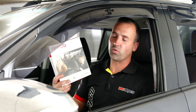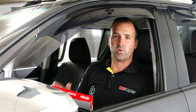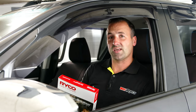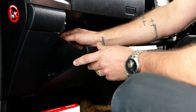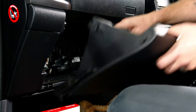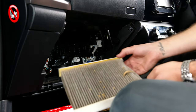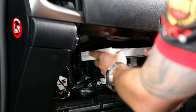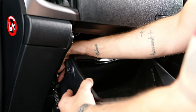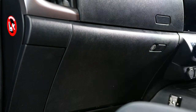While we're fitting filters today, we're also going to chuck in a Ryco cabin filter. The filter we've chosen is the Micro Shield series, which does a better job than your standard factory cabin filter. Fitting this is a pretty easy job — we drop down the glove box, a couple of clips on the inside edge, and then remove the panel cover. The old filter is full of muck. We toss that out and chuck in the new one, which has antibacterial protection, allergy protection, and an odour barrier. They recommend replacing these filters every 15,000 km.